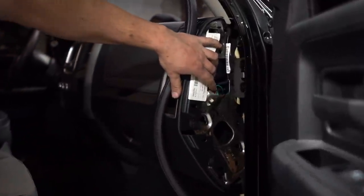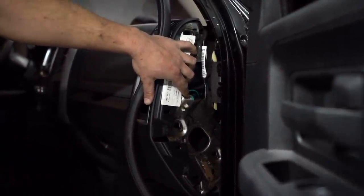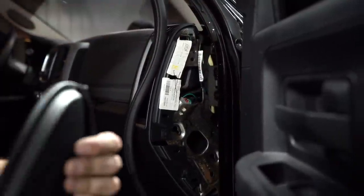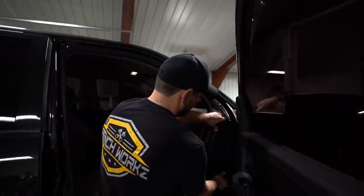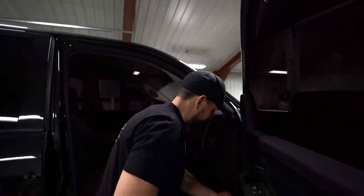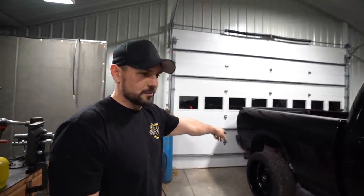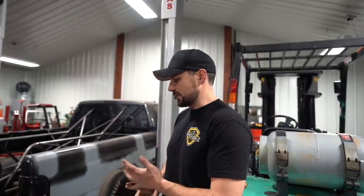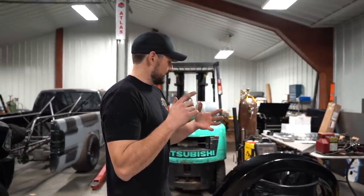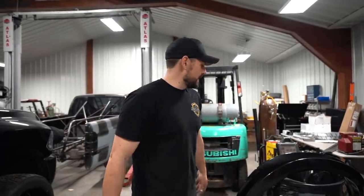This plug right here — if you can zoom in — this is actually your factory connection for cab light power. Mine was a white and green tracer wire. So if you guys are putting cab lights on, that is where you need to get power, at least in our case. Got that done. Rear parking sensors are back in and painted — you can actually paint those. We also painted the lower valance again. Not everybody's cup of tea painting stuff that's already black, but it just turns the black plastic into a really nice look.